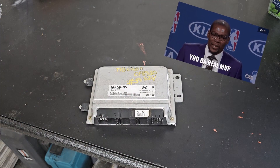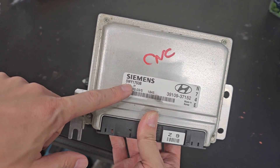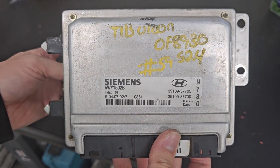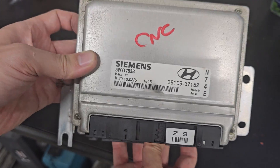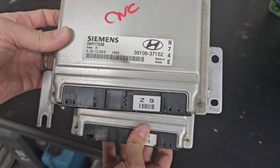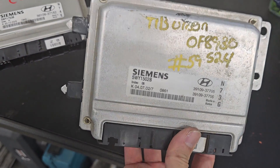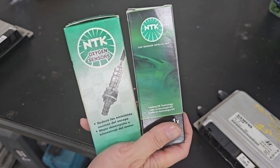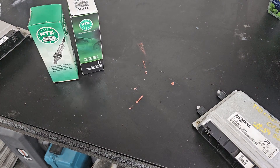Clearly they did it with the wrong one. I did some research and Chase over at newtiburon.com helped me out a lot — shout out to Chase. I got this replacement ECU, which is from 2003, and more importantly it's a 5WY17 version whereas the other one is a 15. The main difference between the 15 and the 17 for our purposes is that the 15 version runs on a 5V O2 sensor system and the 17 version runs on the 1V system, which my car uses because it's a 2004. Somewhere in 2003 Hyundai switched from a 5V to a 1V system, so my car is a 1V car but it was running a 5V ECU.